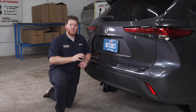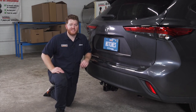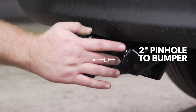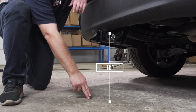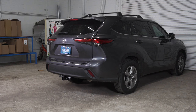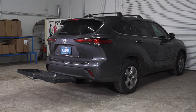With our hitch installed, we pulled our vehicle down onto level ground to show you some important measurements for your hitch accessories. This is a two inch receiver. From the pinhole to the edge of the bumper is two inches, and from the ground to the top of the receiver is 15 inches. This will help you determine the length, rise, and drop for your hitch accessories such as a bike rack and cargo carrier.